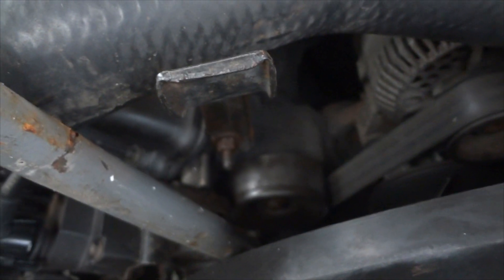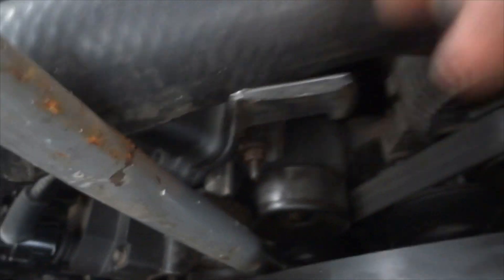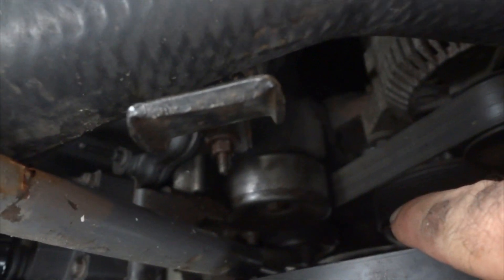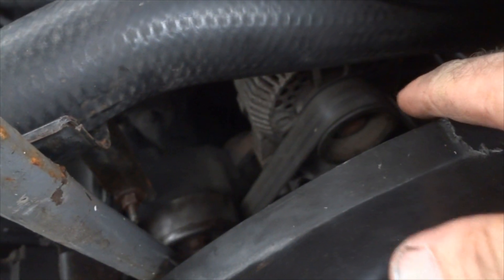I forgot to make a video where you could hear what it's doing. First thing you got to do is go under the truck to put the breaker bar on the belt tensioner — it's very hard to pull, so I made this cheater bar and put it on here. See the belt? You have to get the belt off of the alternator to be able to get to the idler pulley.